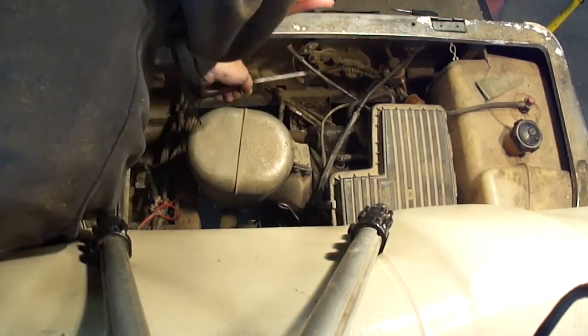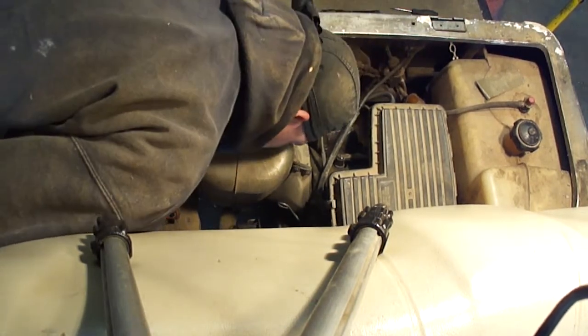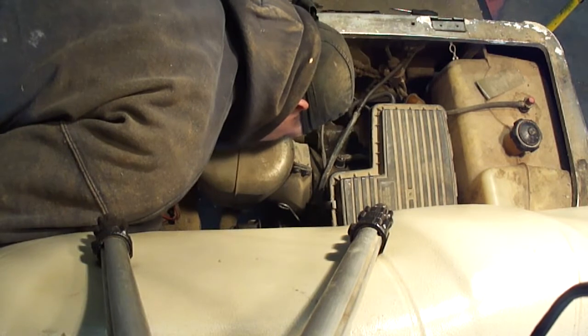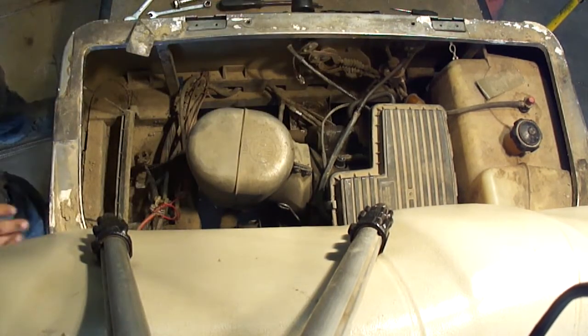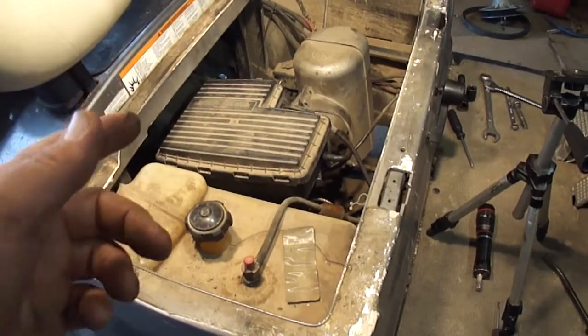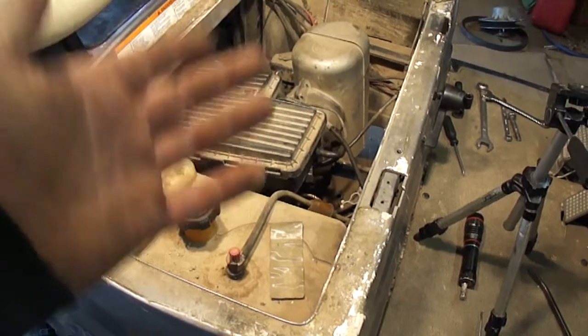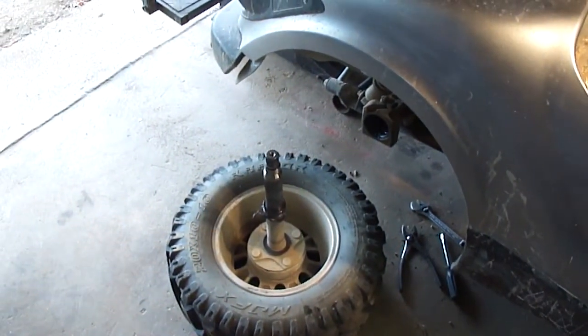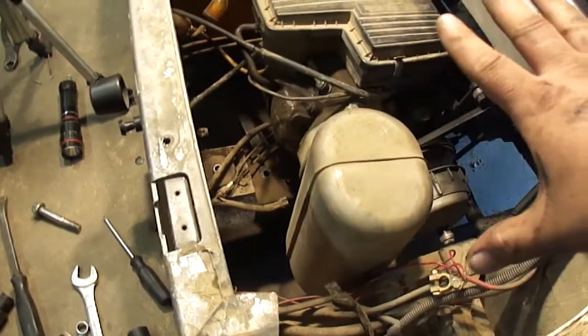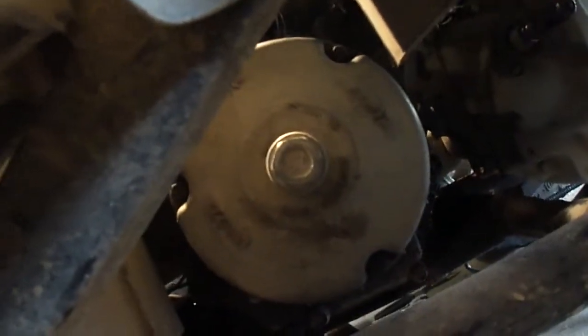Okay it's not wanting to go, I'm not sure what's holding it up. I may have to unbolt the shocks too. Wow, what a pain in the ass. When I unbolt the shocks that means I'm gonna have to support the cart up on jack stands and essentially lift the cart off of the motor. So things have escalated quickly here — I'm gonna have to jack this up and put some jack stands under it to get the shocks off so that this will move back far enough to drop down. And the axle fell out. It looks like the bearing is what holds it in and the bearing failed too. It never ends. I got the sub chassis frame deal here unbolted and lowered down and now I can get to that bolt. So all this just to remove that one bolt right there.